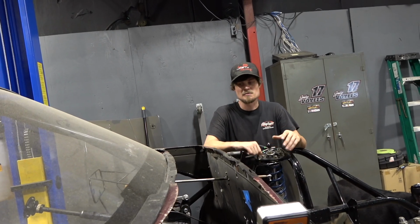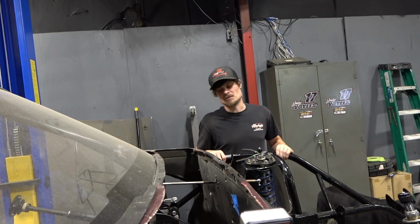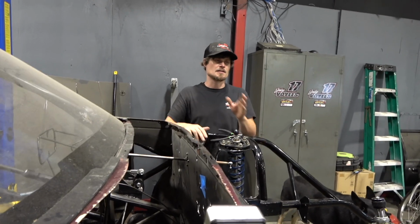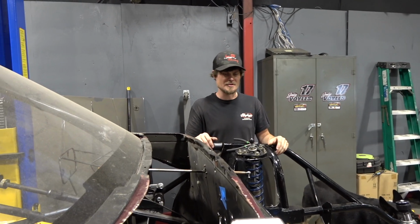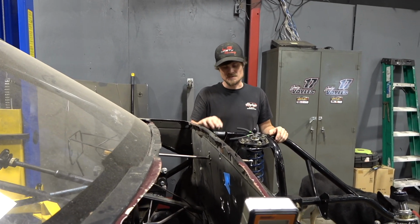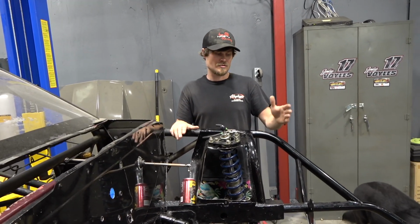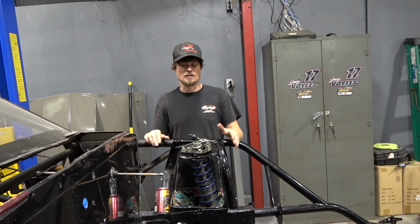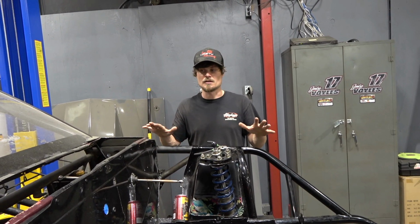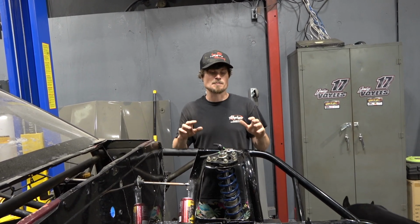We could see, maybe this one had a large small block Chevrolet and a Liberty in it. Yep. So it's probably, if we can just get one in the back and then come off and weld a tab with a flat, the transmission mount in the rear is very easy. Mainly just getting the mid plate, make sure everything's square. We're gonna get our string line and try to find center line of the chassis as best as we can. Just do everything we can to get it in there as close to perfect as possible.